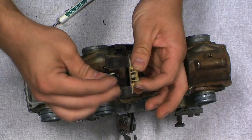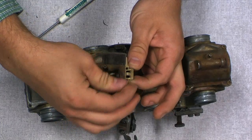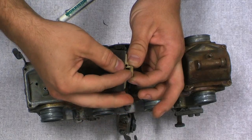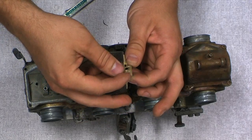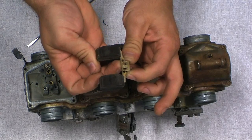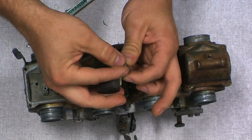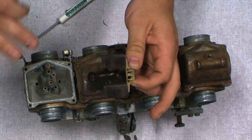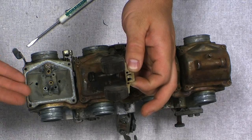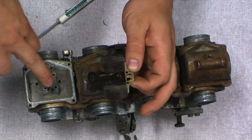in here, this little valve sits on top. He's got a little cone on the end. Once the fuel hits the specified level set by where this little tongue is, it will cut off the fuel flow. So you've got a set amount of pressure behind the fuel pushing on the top, which would in turn push on the jet on the bottom.